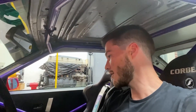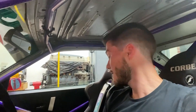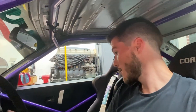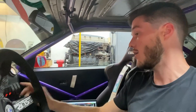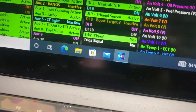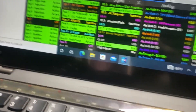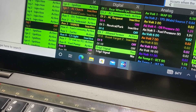So let's go ahead and try this. ECU on. Trigger signal two — we've got them. Now I'll shut it off and we'll cut the car on. We'll wait. There's trigger signal two. It's there. It's gone now. We'll start without it and it will never keep it. So all we have to do now is cut it on while trigger two is active and it'll stay on.